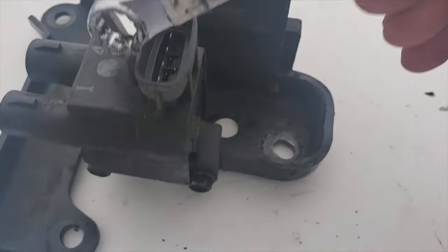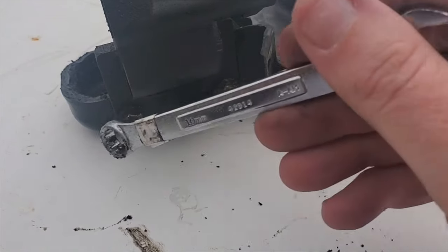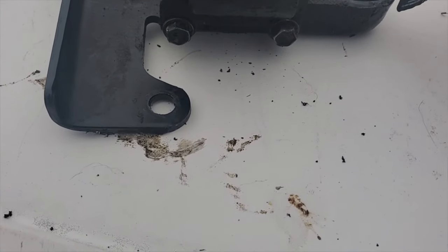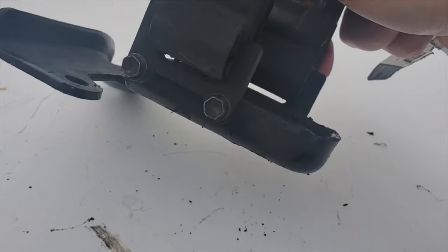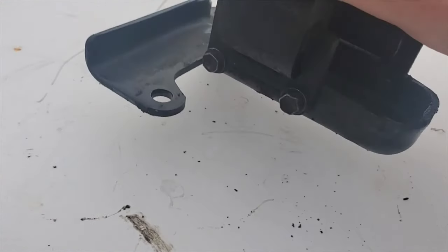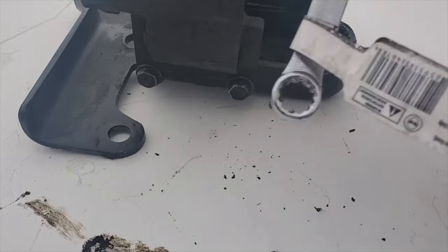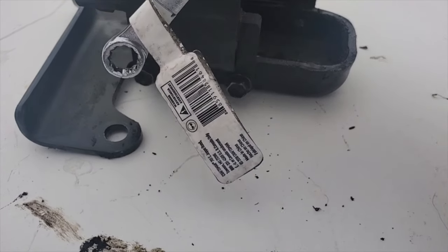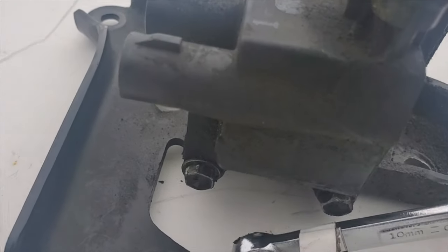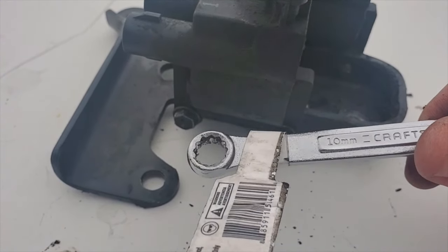Now that I've got the coil pack bracket and the coil packs on my pretend vise here, it's time to remove the 10mm bolts. This is the 1 and 4 pack, which is what we're doing today — remove these two bolts here and here. This is the 2 and 3 pack — again, these two bolts here and here. Now you have several means as to how to get these off. If you could put the bracket in a vise, you can pop these two loose and pop the other two loose off. You could use a pneumatic ratchet with a 10mm socket and buzz these off. Or you could use an impact gun with a 10mm socket — buzz these off in the back as well. Be careful when you tighten it down so you don't break things. You could also try to hold it down with your foot or hand and pop these loose with a 10mm wrench or socket.